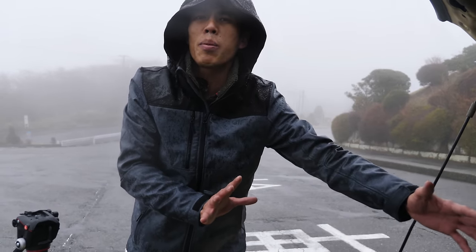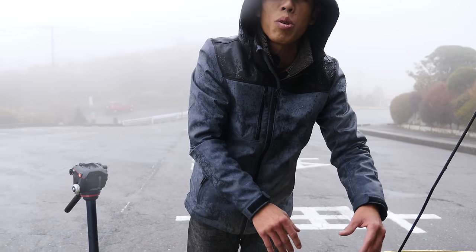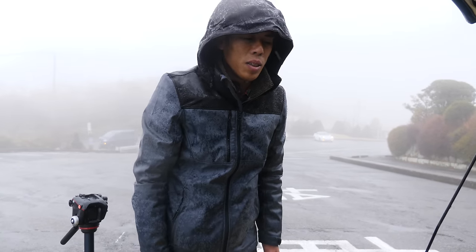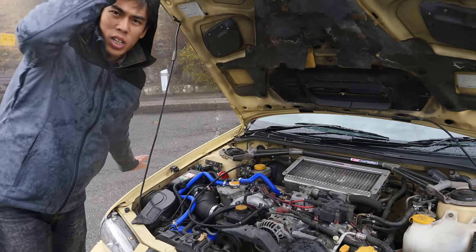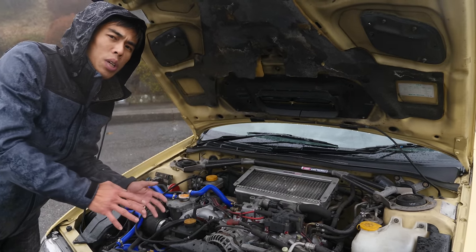One characteristic of the gearbox is that it houses the front and center differentials with the front shafts all in one unit. So for example, changing oil, you just have to do it in one go. That's quite a very convenient thing. The boxer engine is a short stroke compared to the Mitsubishi 4G63, which is a long stroke.